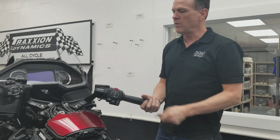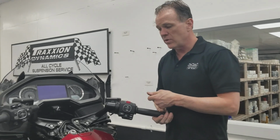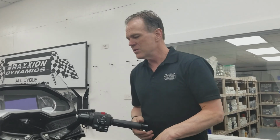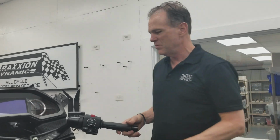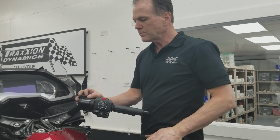Here was the trick. So we went to tighten the crown nut, and the problem is when we go to torque it, the first impression was that the nut was stripping because we were trying to tighten it and it wouldn't tighten. So after it took some figuring, it will be obvious when I tell it to you, otherwise you wouldn't get this. But the entire assembly is spinning because there's nothing to stop it.